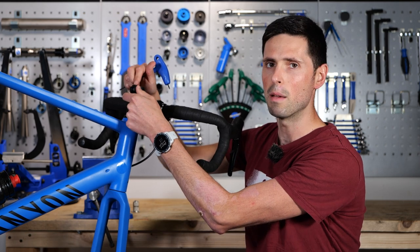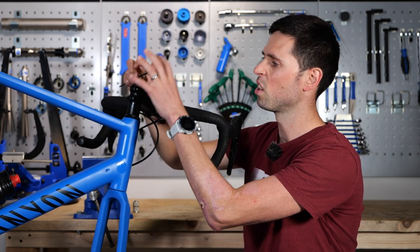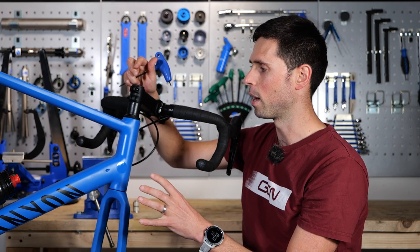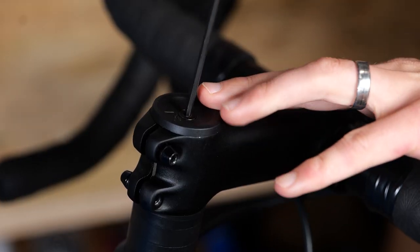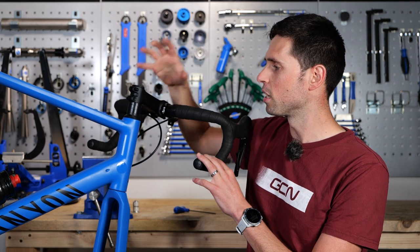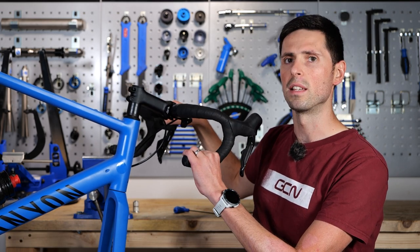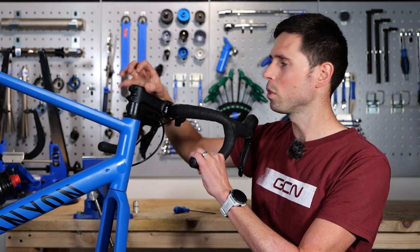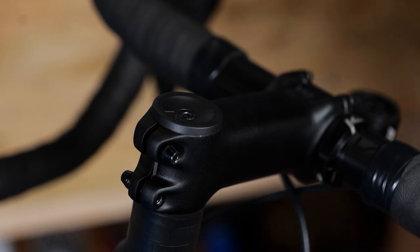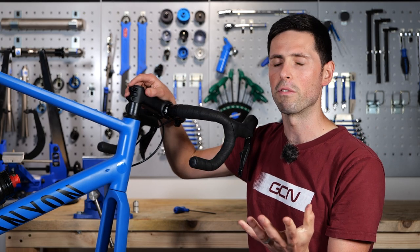The important part to remember is you don't have to do this up very tight, and when you are trying to adjust it, you should have the stem bolts loose so that any force that you apply through this top bolt goes all the way through all the bearings all the way down to the lower bearing as well. That way, you're going to apply that preload across the whole system. Apply too much force or preload down this top cap bolt and you're going to cause accelerated wear on the bearings and cause your steering to have noticeable resistance. If we're trying to put a number onto the force put through this top bolt, you're looking in the region of around two Newton meters. In essence, it should be as loose as possible whilst removing any free play from that system.